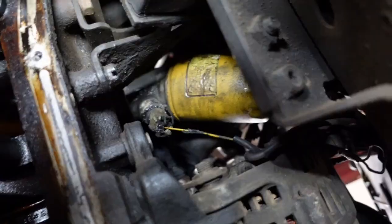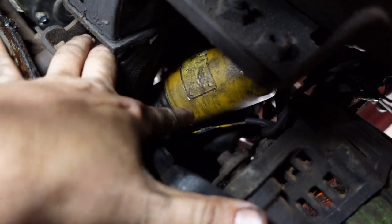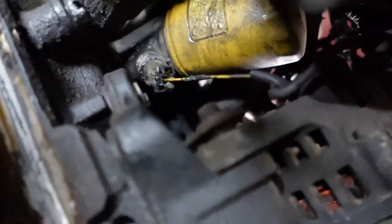We're going to show you now where to tap the oil feed on the block. It's this white thing right here — the plug with this wire going to it. I'm up under the truck with the oil pan off. You just unplug this and back the sensor out. I'm not sure what size that is, but that's where you put the T. You put a T, then you put the oil feed into the T, and then you put the sensor on the other side of the T. So we're going to see if we have the right size T.